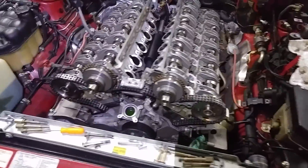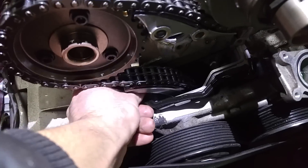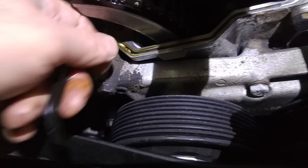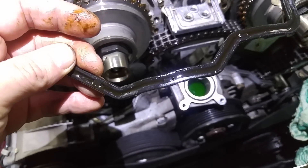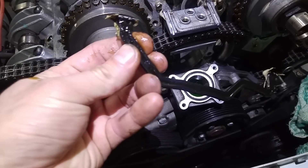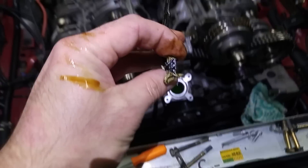So this is the second part, basically. What I'm going to do next is start cleaning everything off — all the silicone that was installed by the factory many, many years ago. You can see I'm removing the gasket right now; there's a bunch of silicone. This gasket seems kind of wavy, which might be why it started to leak — but they all leak. It's sort of like a factory defect. It's not hard, still kind of pliable, but that's basically what it is.